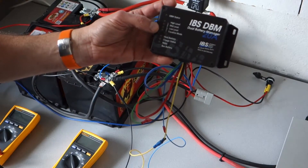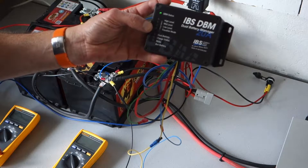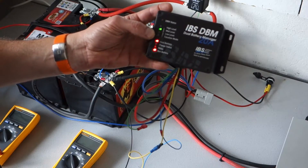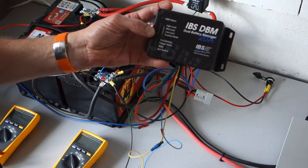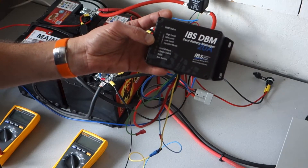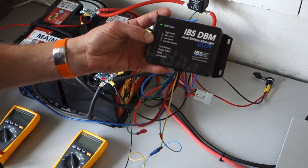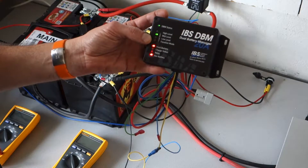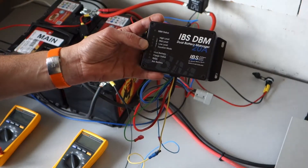Low level is mainly used for most gel batteries. Mid level is used for AGM batteries and lithium type batteries. High level is for AGM batteries, round cell batteries like Optima batteries, and some lithium type batteries. Low corresponds to 14.0V charge voltage, mid to 14.4V, and high to 14.8V.